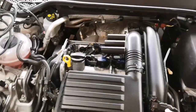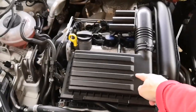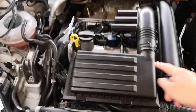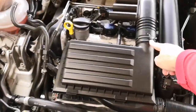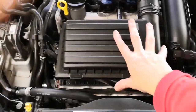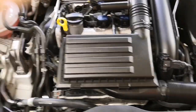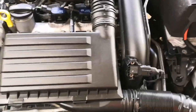What I have figured out is that this is the turbo boost pressure sensor, and the manifold pressure sensor is located underneath the air filter. So what we've got to do is release these clips, this little breather valve here, and lift off this unit before we can go and fit the actual chip.